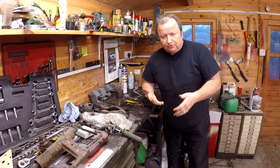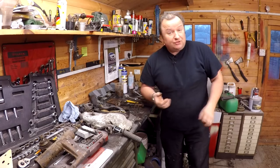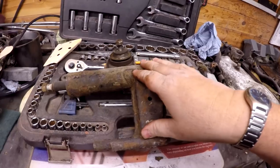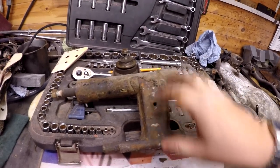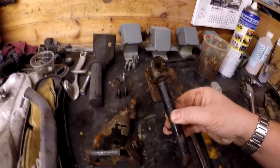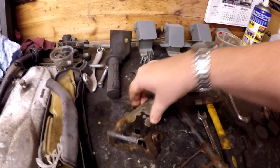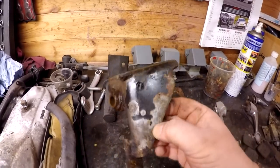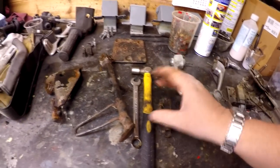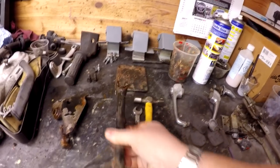Right, okay then. I've got loads of odds and sods to sort out. This is our swinging arm for the Piaggio moped — full of rust. So are all these other ancillary bits, like the engine case and the side stand. I did try to put that in the vinegar bath but it wouldn't take the paint off, so it's going to have to be sandblasted. I've actually stripped the components down so it's a lot easier to clean. We've got to get all this painted and resprayed.